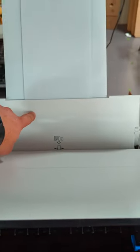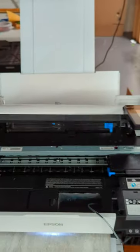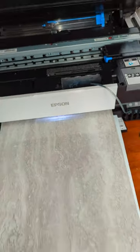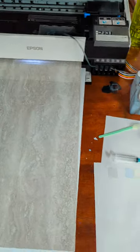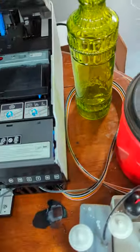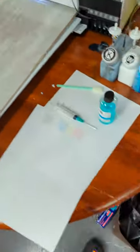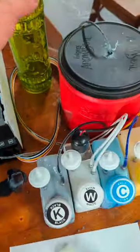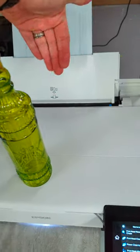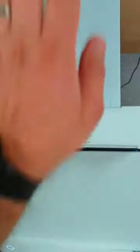Exit tray — I remove parts of it and use some of the same sign blanks right here. It just allows me to use a longer print. I think I've done up to four and a half feet on a single run print-wise and it does work — you just have to make sure your ink is full. This bottle here — it was convenient that the end of the power cord right there will fit right at the tip of that. The heat press is hot, so it'll just hold it and keep me from having to chase it around. This also serves the purpose of — drop the lid down, put this right here, drop film in there to feed normal, and then this will just curl the film up right here and hold it in place, so I don't have to fight it going all the way up and over the top.